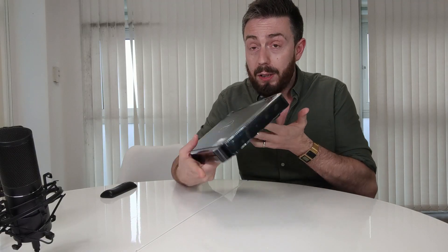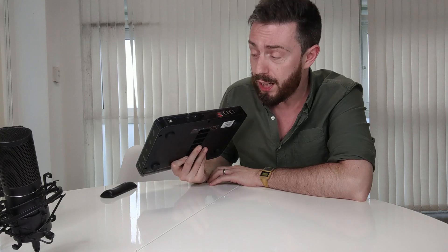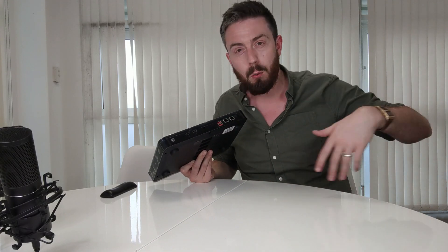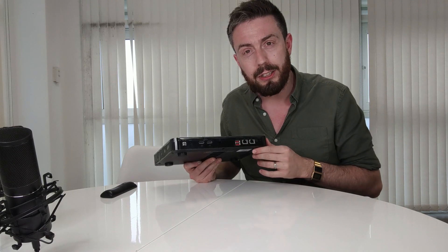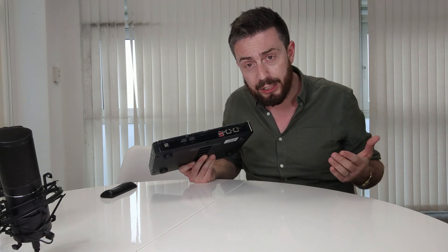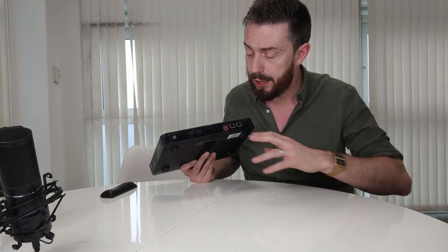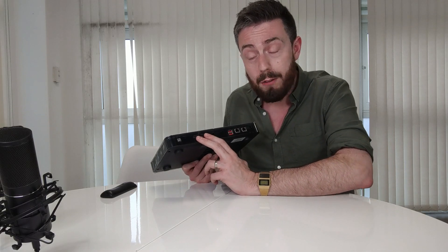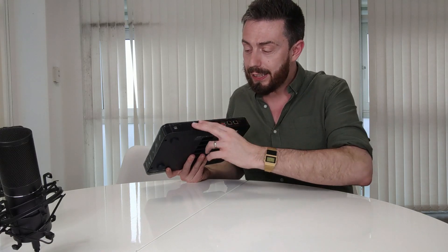Continuing on HDMI: this system has two 4K 60fps HDMI ports, but you cannot use them independently. You can't use one for surveillance and one for multimedia, or run two different VMs in QVMS. You can only mirror or extend the screen. That feels like a real waste of the architecture. It seems like an oversight in QTS and HDStation, and hopefully someone at QNAP can explain why two independent HDMI outputs running different applications and services aren't possible, especially given the remote control was designed to switch between different services.